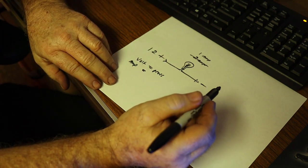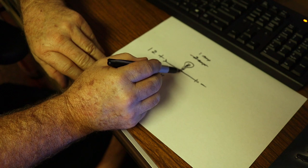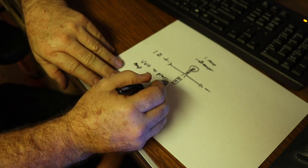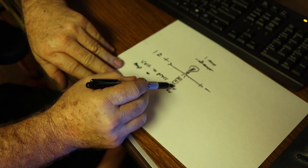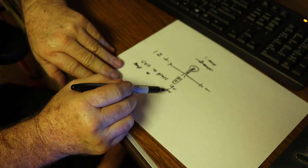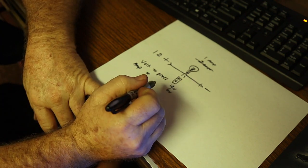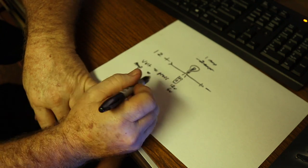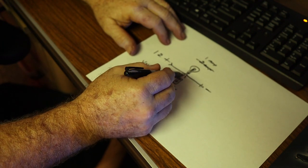What you'll do is take your voltmeter and test first on the voltage side — you're hoping for 12 volts. If you have low power going in and a good ground, it could read 12 volts, 6 volts, or whatever in between. If it's noticeably dim, it's probably down around 8 to 6 volts. If it's 11 volts, you probably wouldn't notice much dimness. Let's assume the problem is not on the voltage side — how are you going to figure that out? That's where you're going to do a voltage drop test, which some people get a little confused about.